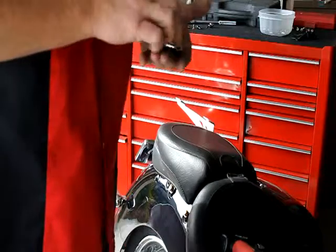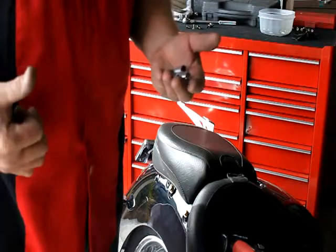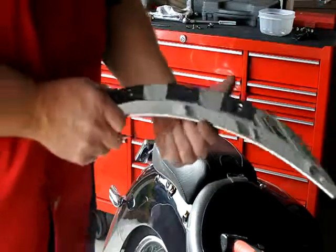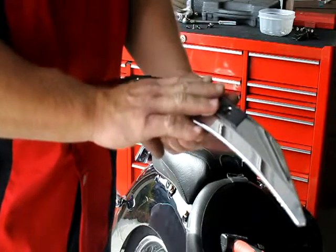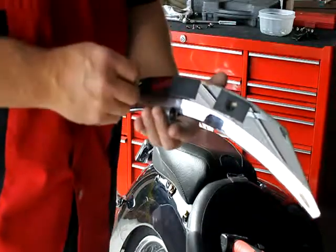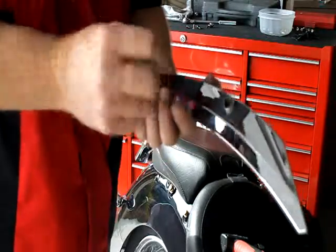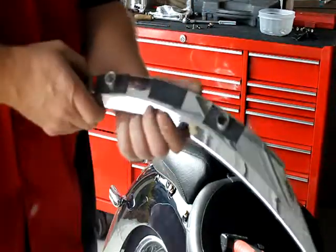Now it's time to finish installing the 481 with the fender rail and the victory bag bracket onto the bike, getting it ready to accept the luggage rack. I have all the pieces here — my fender strut is ready and the protective rubber pieces are in place. This keeps the luggage rack rail off of your fender rail. Put the spacers in the front and rear — wide spacer on the inside of the rear adapter, thin one in the front — and make sure the holes line up before you attach it.